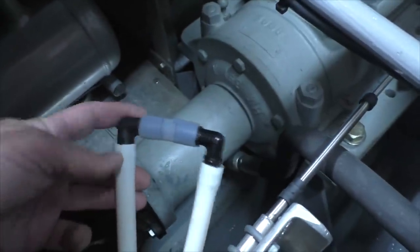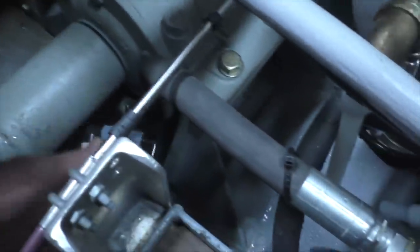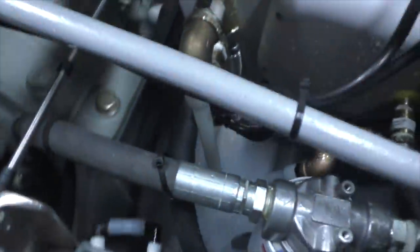I didn't want to pump it into my hot water tank, so I cut the line back here and drained that. Then I just temporarily tied the hot to the cold line. If this works out well, I'll put some valves and stuff in there to do that so I don't have to chop the lines apart. But I do love PEX because it's just so easy to treat it like a hose and cut it, put a new piece back in.